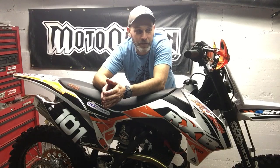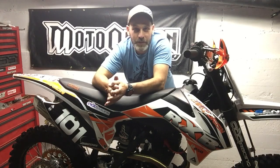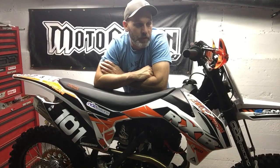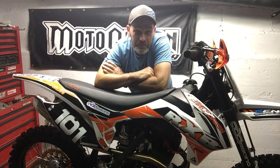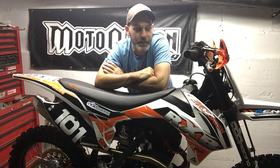Most of you guys probably saw my video. The thing screams. Right from the bottom to the top, you can do whatever you want with this thing now. I was running a 1350 gear ratio, which before the flywheel key and all that stuff, when the bike was stock, was useless. And so through all my testing with all the other cylinder heads, camshafts, I stuck with the 1250, and in my mind, for what I'm doing, you weren't going to beat that. And well, lo and behold, this thing will hold the 1350 with ease.